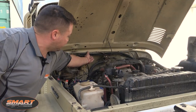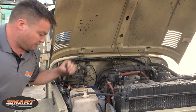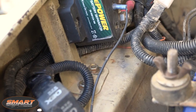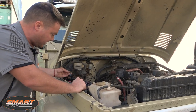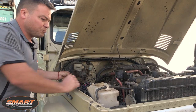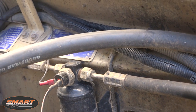As you can see, we've got conduit here that's been added over the years — loads of it. We're going to consolidate that into one conduit. We've got relays here that are just taped up — it still works, but that's not ideal. We've got fuses just hanging around. I like putting IP68-rated connectors on there. It's just a mishmash of wiring in here; we're going to tidy it all up and it's going to look awesome.